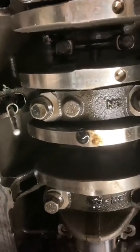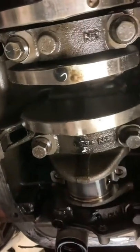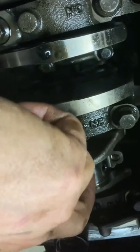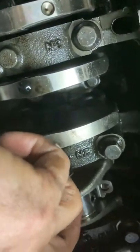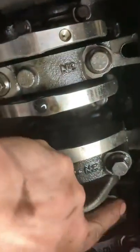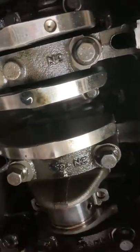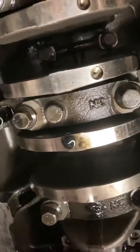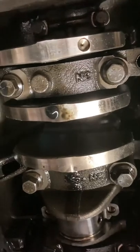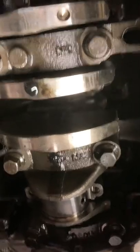eBay — 25 quid set of shells, and that bit is like a tenner. If you've caught it in time, all cool. In terms of the rods, the way to tell how knackered they are is if you can run your fingernail across it and feel ridges — you've got a problem. Also if they go blue, you want them to be smooth. But frankly, at the point where you're here, you might as well put shells on it almost however bad it is, because at least when you put it back together again you can load it onto a trailer to go for scrap.